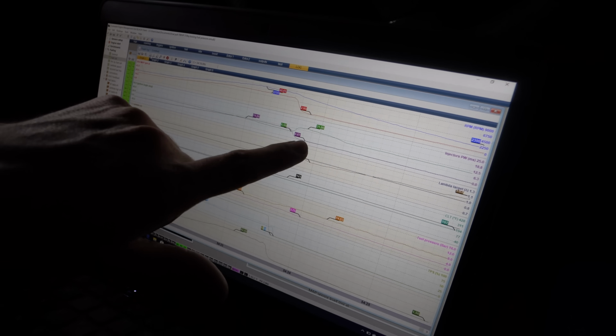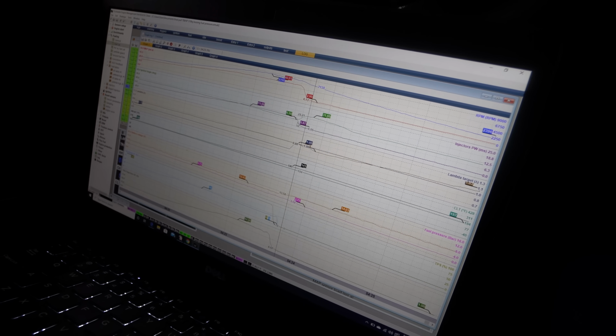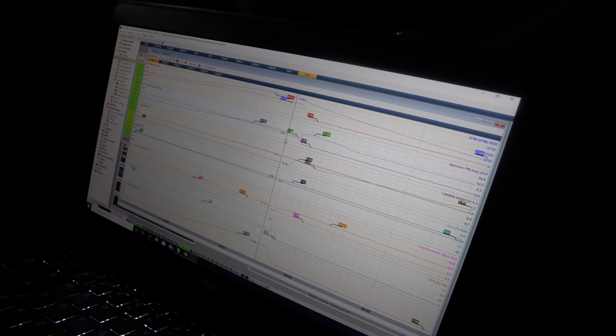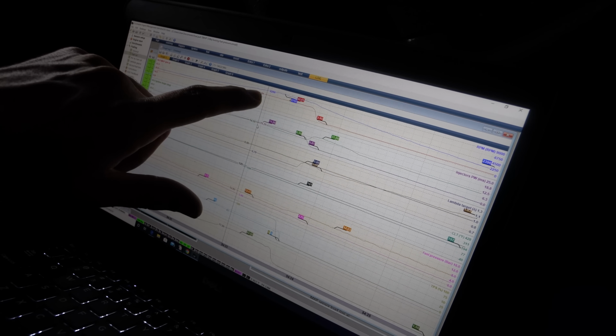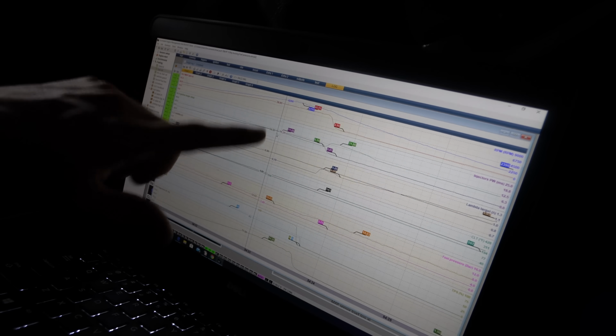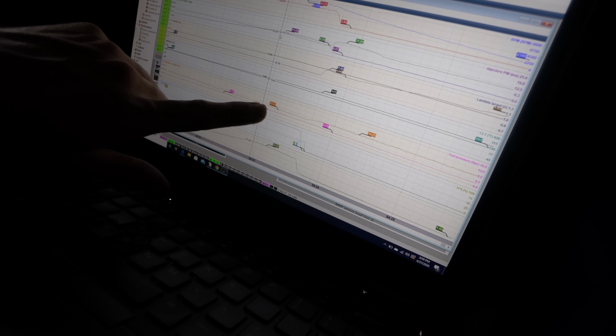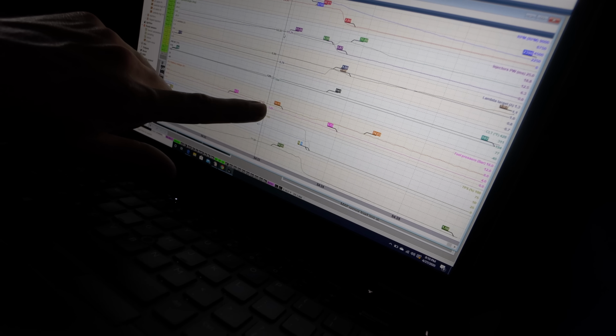You can see right here, we have the injector pulse width, we have ignition angle. Why does it have so much timing in it? No, that's the limiter. Okay. So right here, we're at 14.5 degrees of timing, 39 pounds of boost, which is basically 26, because you have to minus atmospheric. Then we have battery voltage, which was actually dropping a little bit too. We were about 12.8, and then it was dropping to about 12.4. In other spots in the log, it was like 13 or so before we got into it.